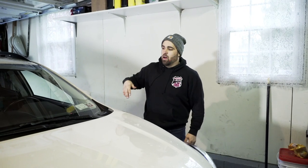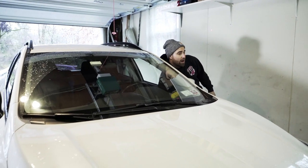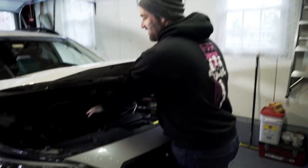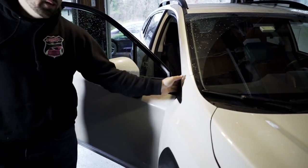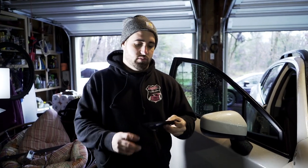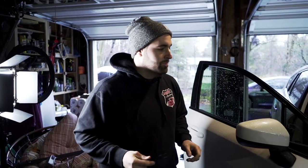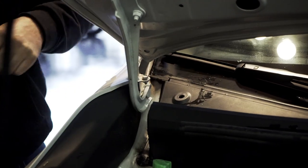Next, we're going to pop the hood — we'll need that for installing the side mount brackets and running wire. Then open your door and remove this plastic piece; it's just held in by a couple of pop snaps, so you just unsnap it off. Save these — don't throw them out — because if you ever put your car back to stock, you'll need them.